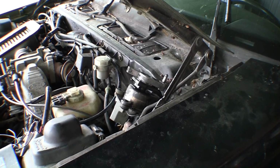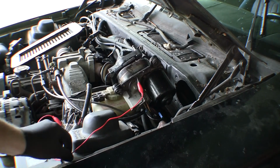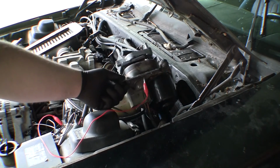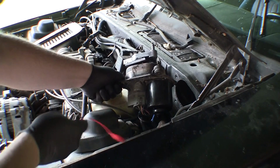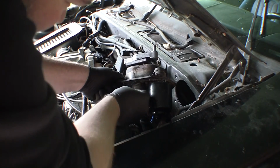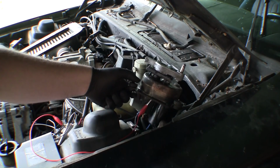No good. Okay, so now I may have figured out why it was sparking. It's because that ground wire wasn't grounded to anything, so now I've got a jumper wire over to ground, and it returned itself too. So that may have been, oh crap, that's going to be hard to keep it on there. May have been the major reason why I'm having so much trouble trying to get this thing tested.